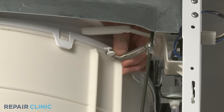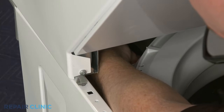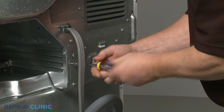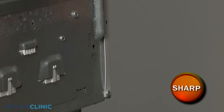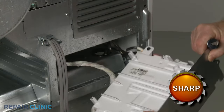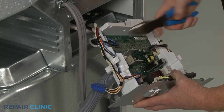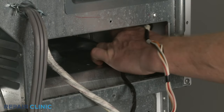To fully uninstall the washer's tub assembly, first detach all four suspension rod springs from the tub cover. Moving to the rear of the appliance, use the 5/16th inch nut driver to unthread the two screws securing the main control board mounting plate to the rear panel. Use the large flat head screwdriver to help pry the plate free and pull the control board housing out. Disconnect the wire connector for the tub components. Unhook the wires from the clips, then cut the zip tie retainer to fully release the wires. Now feed the wires and connector through the hole in the dryer support panel.